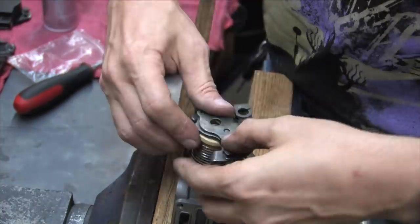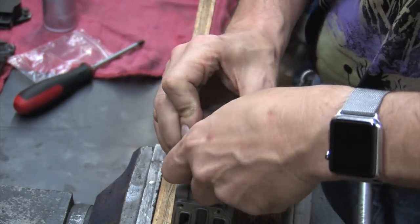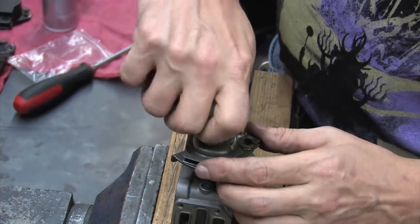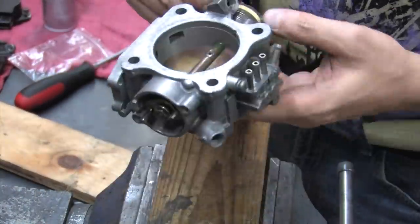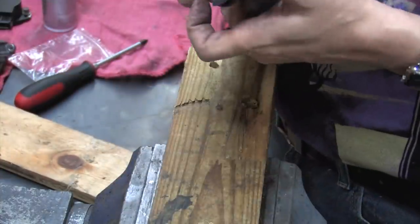Wind this one 1¾ of the way around and slide the throttle linkage shaft into the groove. Put the lock washer and the nut on, but don't hog it all the way down yet. Get a good angle and check to make sure that the nubs on the separator and the linkage are lined up first. Over-tightening the nut before doing this check can actually break these parts. Twist it around and fully seat it.